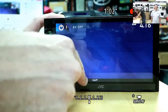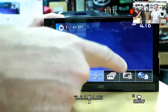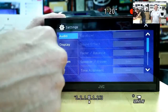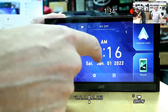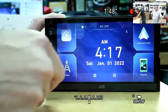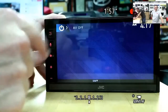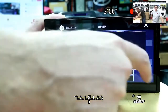For example, that shortcut takes us right to time alignment. If we go back into Settings and change key three from screen adjustment to equalizer, then back out — any time you pop that function menu, it takes us directly into whichever setting you selected. If it's grayed out, it's because you don't have an AV source selected. Once you go to tuner and hit function — boom, EQ quick and easy.